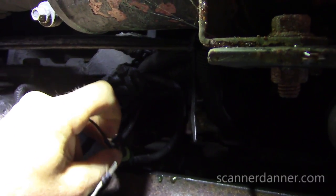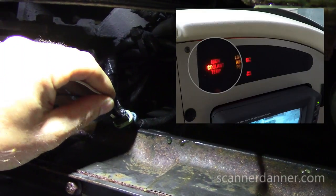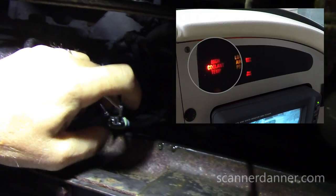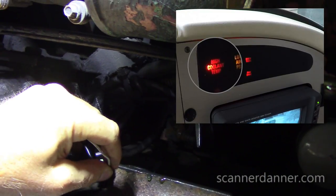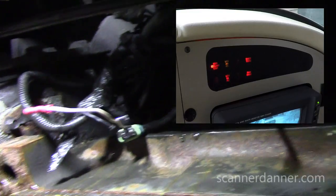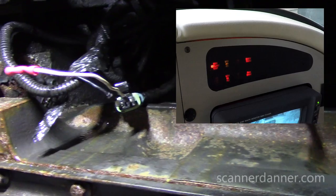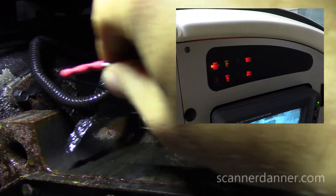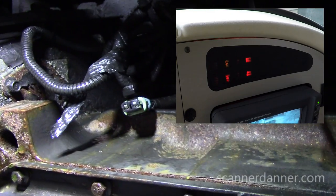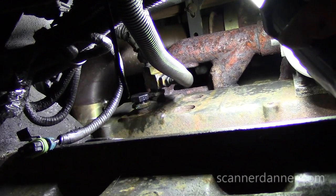I really think it was broken the entire time I've owned this rig. This is a temperature sensor of some type — it's in a water jacket — so I'm jumping the two together. It's basically a coolant temperature switch that controls an overheat light. It's not typical that they would use a two-pin for this. Watch the light go out when I unplug it — now I at least know what I'm dealing with.